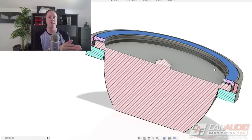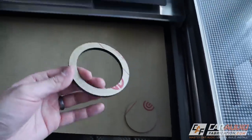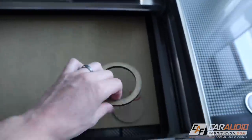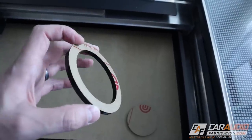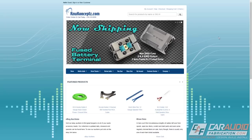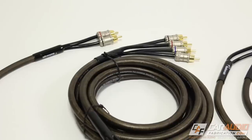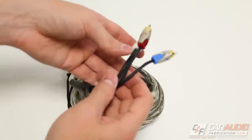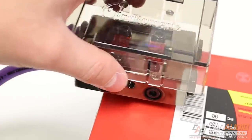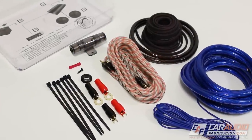I'm going to start exporting all of this geometry in two dimensions so I can start making my cuts on the laser machine. Here at the laser — it's a little noisy because the exhaust fans are running — I'm using quarter-inch thick black acrylic. I've got the file set up in my software and did a test cut first just to make sure the settings are good, since with a laser there are a lot of different settings you need to dial in. A quick thank you to our monthly channel sponsor New Concepts — my go-to source for car audio wiring and connection accessories, including power wire, RCA signal wires, battery terminals, fuse blocks, and distribution blocks. Check them out at newconcepts.com.